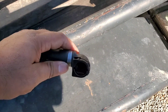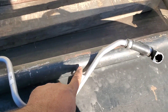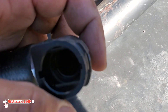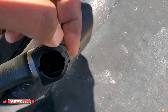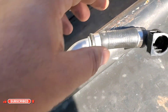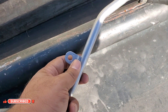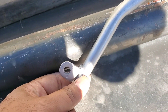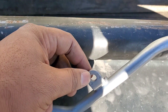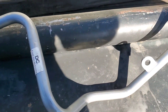The new line is very easy to replace. All you need is to put these two screws on and then just run the line. There's one hook right here — you pull the hook, push it in, and push it down and it should lock. This pipe is flexible, it's like a rubber pipe right here, and the rest is rigid pipe. They upgraded it because it was a very common problem, and the metal clamps were actually destroying the old lines.